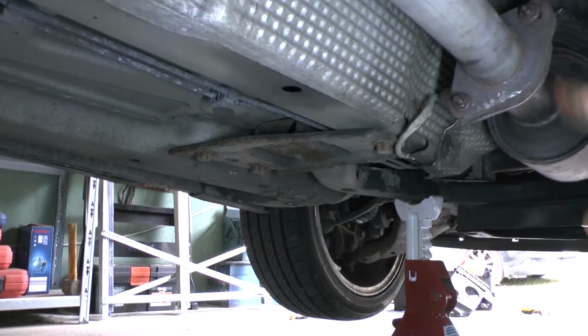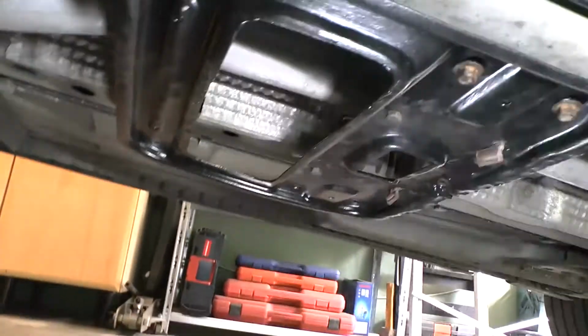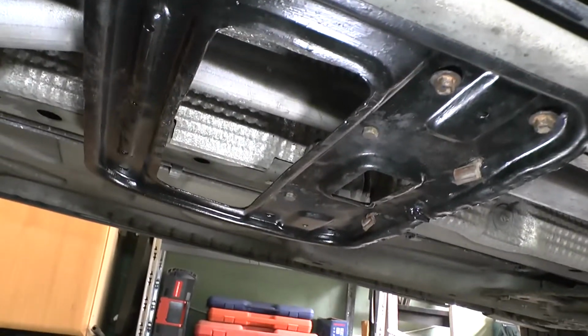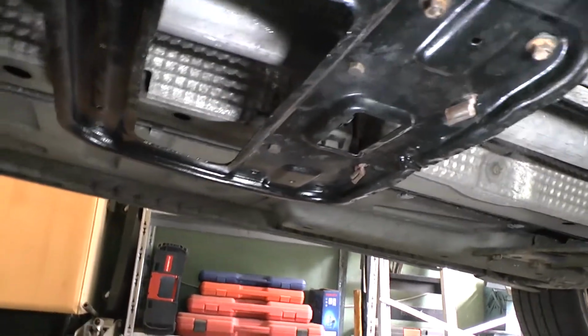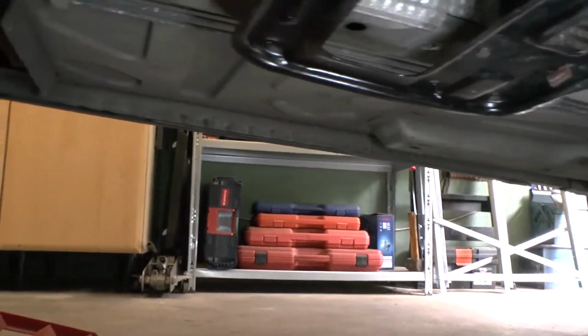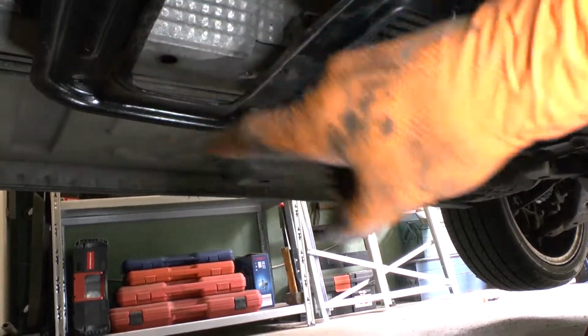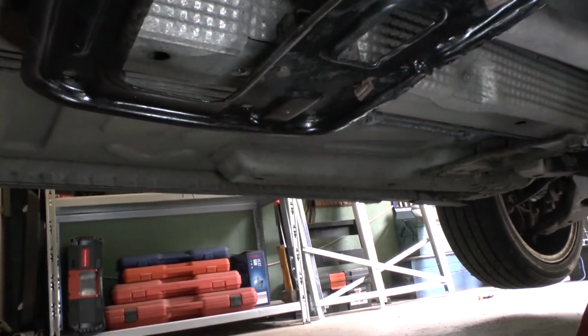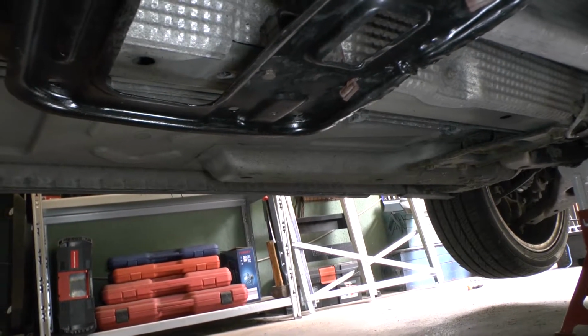Right, they're covered in copper grease, and then this plate, which I had on upside down earlier, I didn't realise, that's got 2 little bolts to hold it to the rubbers. The rubbers go through the holes here and here, and then 2 little bolts 10mm, and then 6 10mm around the edges there, again covered in copper grease. So I only got 3 of them in. I'll do the other 3 now in a second.